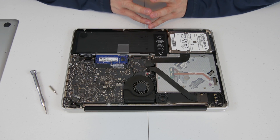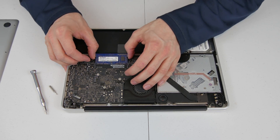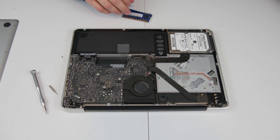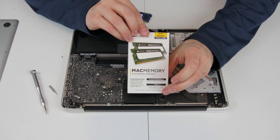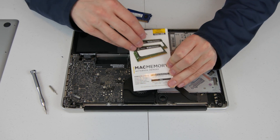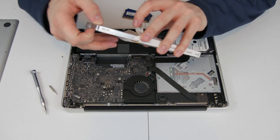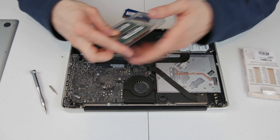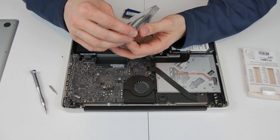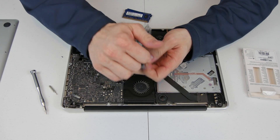The easiest aspect of this is going to be replacing the memory — it is right here. It is super easy. All you do is pop it out just like so. And then I have the Mac memory here — this is just regular DDR3 1066 2x4 gig kit. I will link that in the description so you can find a similar product. If you're looking to find what memory your computer needs, you can go to crucial.com — I'll link that in the description as well, as it will tell you what fits in your computer.